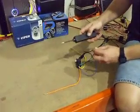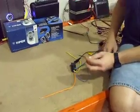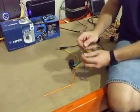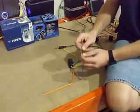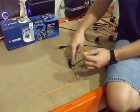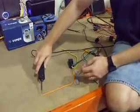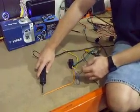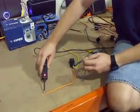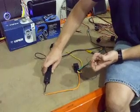So this here is my test light. I have the ability to actually throw ground or 12 volts out of it. This is my negative out of my power supply. And when I touch it here, you're going to hear a click — that's clicking that relay. So when I do that action, it's going to put constant power on this wire, which it received from the top pin on the relay. To demonstrate: if I put my test light on pin 30, the output of my relay, it should show absolutely nothing. Now when I ground 85 on my relay, now I've got 12 volts. So whenever I take ground and apply it to pin 85, this is what you're going to see.